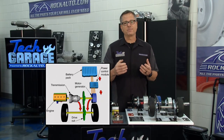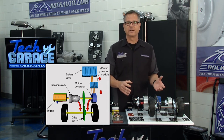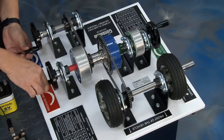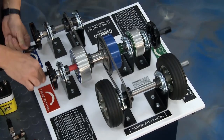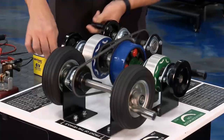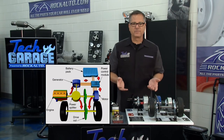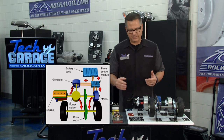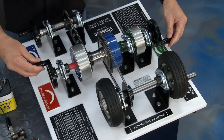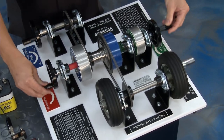If you go to the next graphic, that's a parallel. We're going to use the ICE — the internal combustion engine — and the actual motor generators to work together. Listen to the difference and watch how easy it is — I can actually spin it. My ICE motor is helping the actual motor generator; you see that on a lot of hybrids. Now what happens with the third one is a series-parallel. You get a splitter in the mix — you can use the ICE to charge the batteries, and the ICE can also help drive the wheels. If I drive them all, it's super easy — I've got two motor generators running it and everything's going.